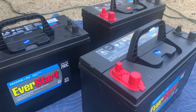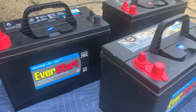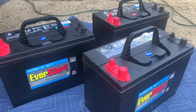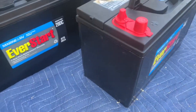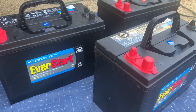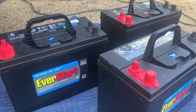You don't want one battery you've been using for a year and then add two new batteries to it, because the older battery will drag down the other two. You also want to make sure voltage is the same — you'll typically only find 12-volt batteries anyway. Most importantly, make sure they're all the same capacity. Group 29 batteries come in several sizes; my previous ones were 845 CCA and these are 875, so the rules for parallel are: same age, same usage, and same capacity.